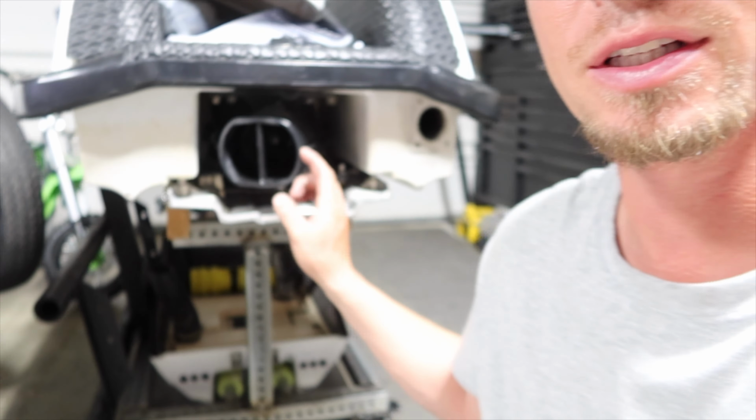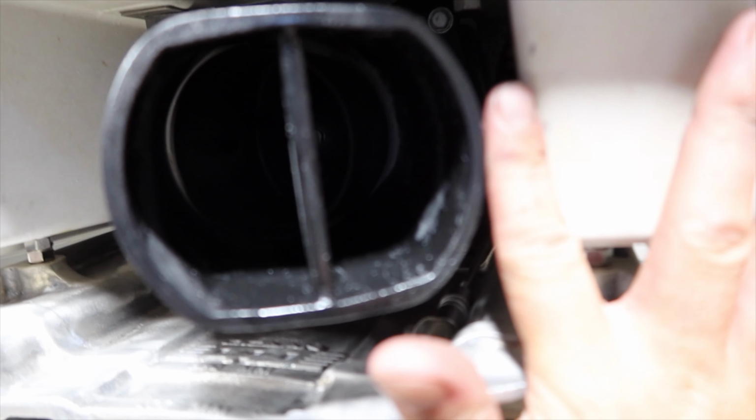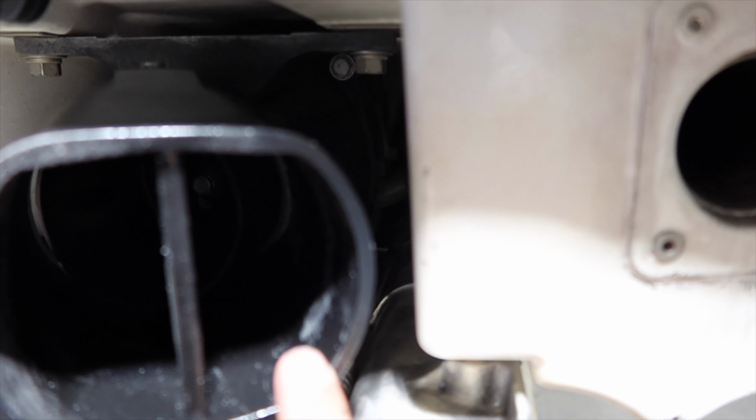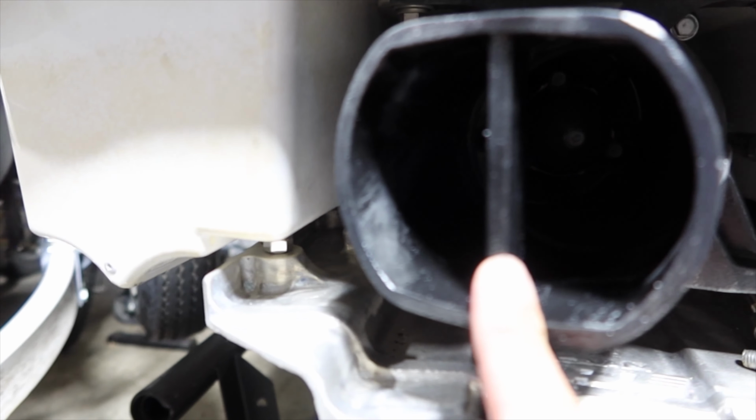Well, we've done the knife blade, as you've seen, and now we've got more problems. It actually hits on a couple things inside of the housing area, or what it rides on, the jet pump. If we swing it all the way this way, I've got a pretty good 2-finger gap, and if I swing it this way, I've got a 1-finger gap.